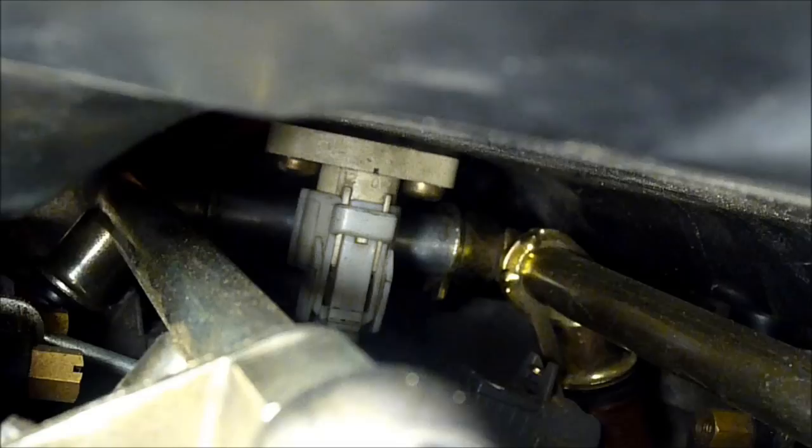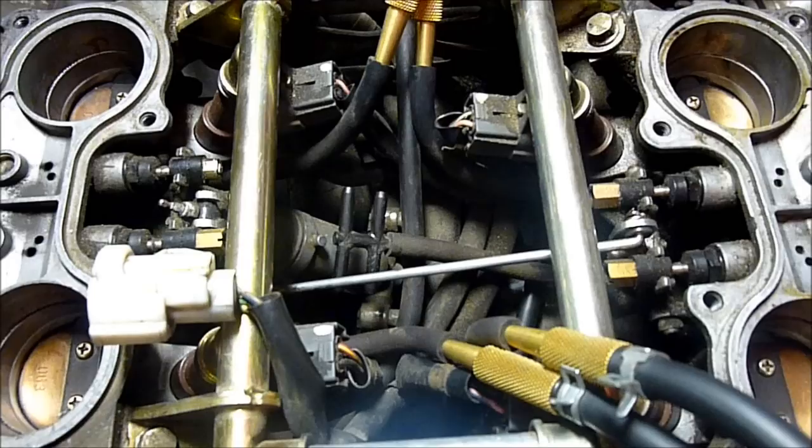With a slight wiggle, just enough to get it loose, and if we look underneath you'll see there's your IAT sensor connector — you've got to pull that. With the MAP sensor I'll remove the vacuum hose and then electrical connection, and then I'll do the same thing for the flapper valve. Air box is off, and these are my throttle bodies. You can see I've connected my vacuum hoses from each intake port up to my synchronization tool. The hoses I've used are the ones which go to that four-way, five-way joiner piece just there, which normally goes to the MAP sensor. This is a non-California bike model — that is the only vacuum hose available on each intake port for you to use for synchronization.